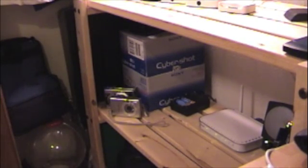So how do I get this up? I'm going to show you how I configure it. The catch is I have the Ethernet cord plugged into this Netgear router. Why am I doing that? Because I want to be able to plug in four Ethernet devices to it. I'm going to show you how to configure the Netgear router to do that as well, because I basically disabled the DHCP server on it to make it act as a switch, but we'll get there in a minute.